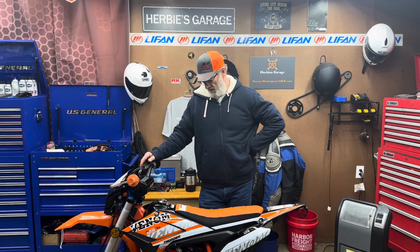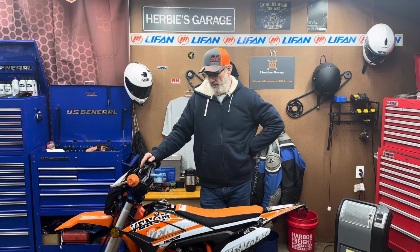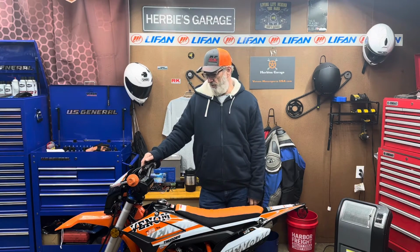I couldn't find anything in the owner's manual about the valve adjustment. So I just kind of did some research. This is a really similar design to the CT models of the Hondas. And 3/1000 is a pretty common adjustment on intake and exhaust. So that's what I did, and I think it's going to be fine. The adjustment on it wasn't off by very much. The intake valve was a little bit tight. Other than that, it was really good.